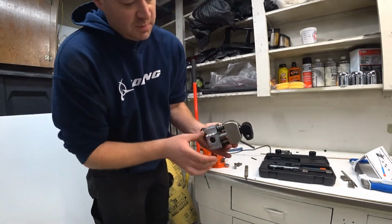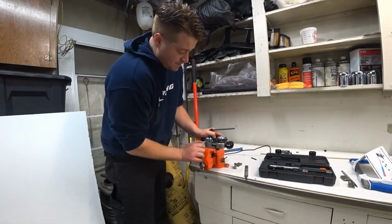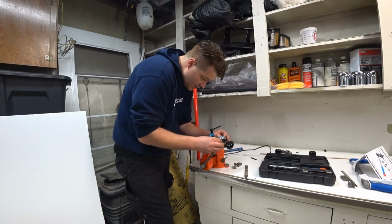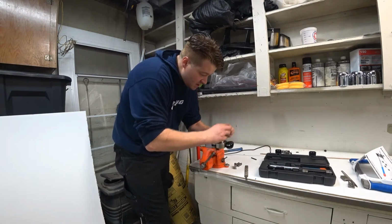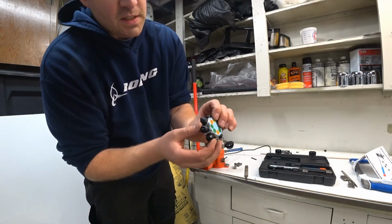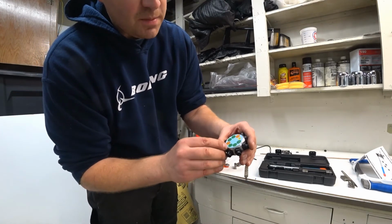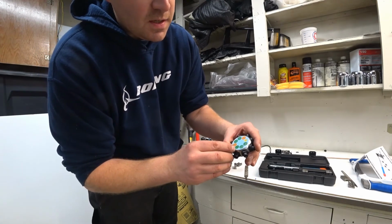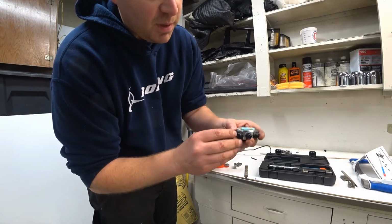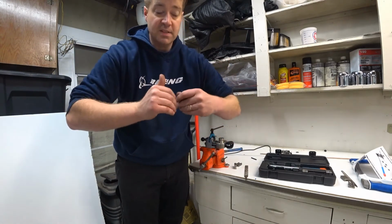This tool looks like it comes with a place to clamp. You stick it in the vise like this. Tighten it down. And then has this little piece here that you rotate. You find, for every size tube, there's two knobs. There's a quarter, and there's a quarter here, and it looks like one of them will make the bubble in the tube, will flare it outward into a bubble, and then it'll cave itself in.